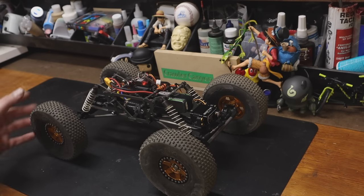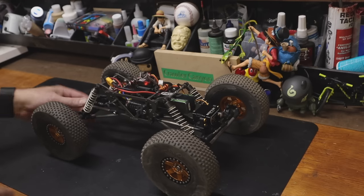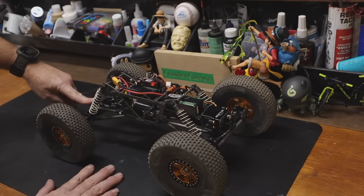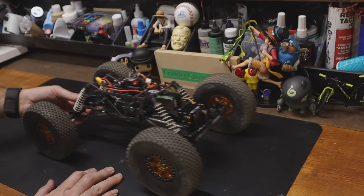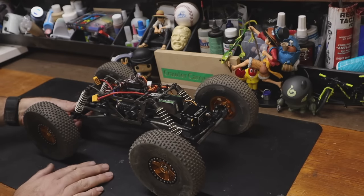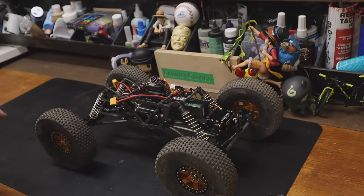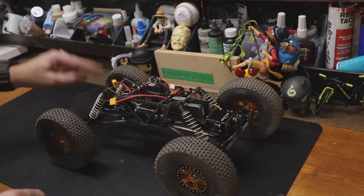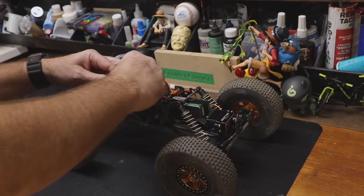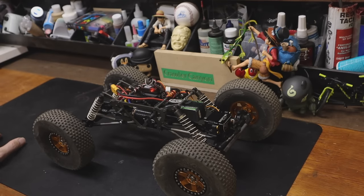There's a grand strength and a grand weakness of the worm drive axle, which is you can't make it roll. And you might say, oh, well, it's powered up. It doesn't matter. You cannot do it, because only the worm gear can turn the ring. The ring can't turn the worm gear. So my guesstimate is that this was a response to the fact that at the time, things like speed controls that could throw out a ton of drag brake, they weren't really a thing.